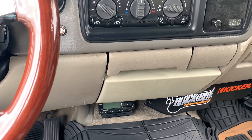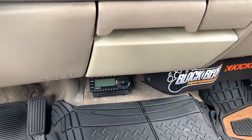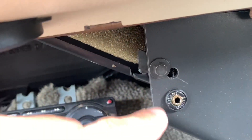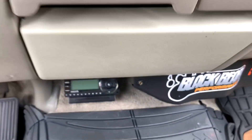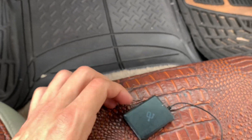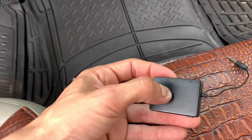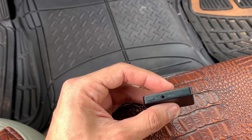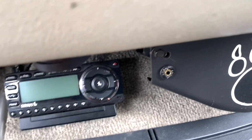For the sound, I did change it up because it goes directly plugged into the module — but what I did differently is I converted it to an AUX jack, a 3.5mm jack. I externally mounted it because I wanted to access it hands-free, so I purchased a wireless Bluetooth adapter. You can find different ones — this is just one kind, it's a Bluetooth to auxiliary adapter and it's rechargeable, it lasts a long time. It has a power button and a charging plug, and you just hook it up right here.